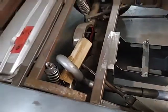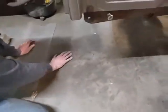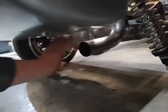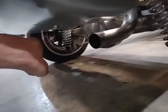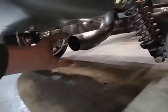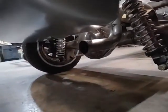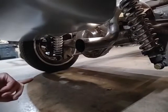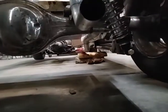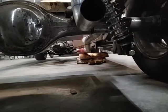And then over here you can look down and see the exhaust coming out. I think I might extend it out a little bit further — I'd like to get the tip of the exhaust out a bit more. But right now it's right where I wanted it, straight coming back. All the welds and joints I've got to finish up, but the exhaust is relatively straight and parallel to the bottom of the frame and tucks up underneath.